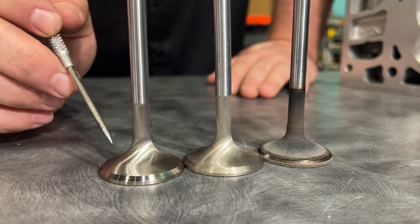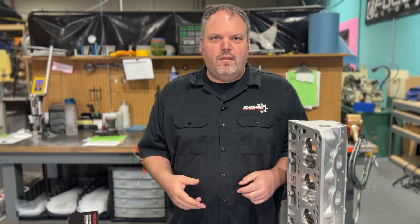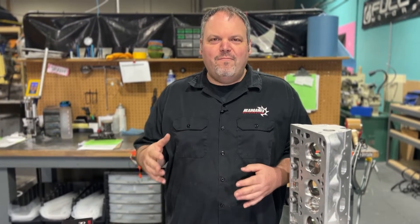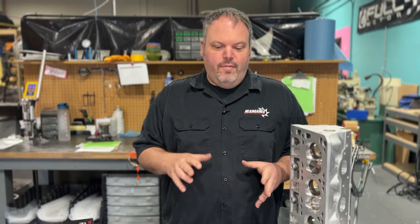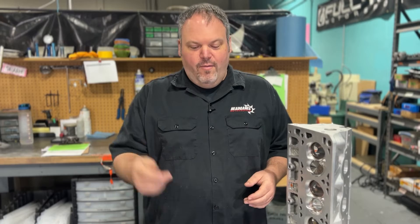There's actually a good 20 to 30 CFM just in the tulip. It should be noted that we only sell this valve for the stock valve size — we only make it in a 150. It's not made for the 1600; the 1600 is actually a totally different valve. But we wanted to help the small valve guys like LS1 and LS2, and that is really its primary purpose. It's also good for boost — pretty much the only reason why we made it. We made it out of good material, increased the margin, and the margin is going to take heat away from the valve. We have everything you need to make that thing a badass.